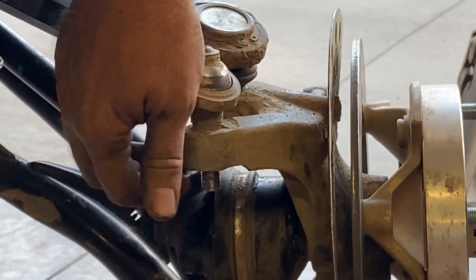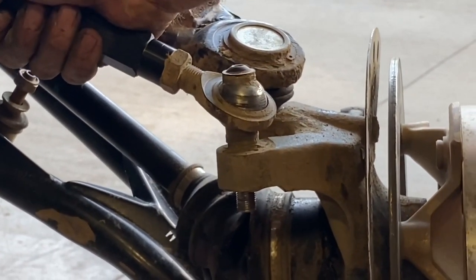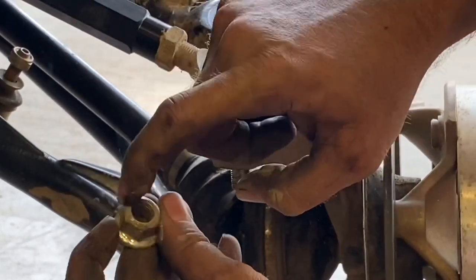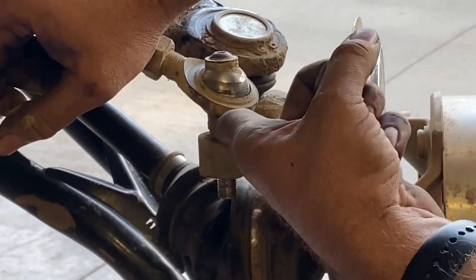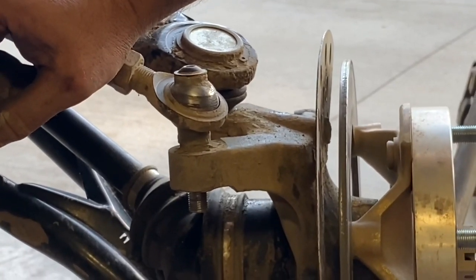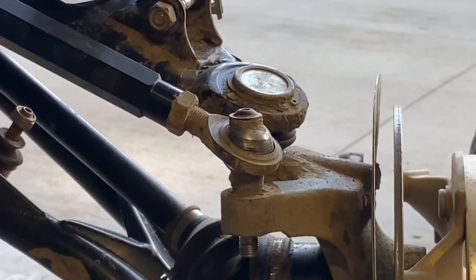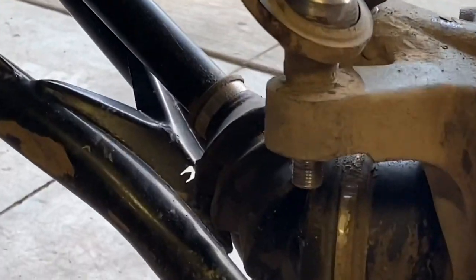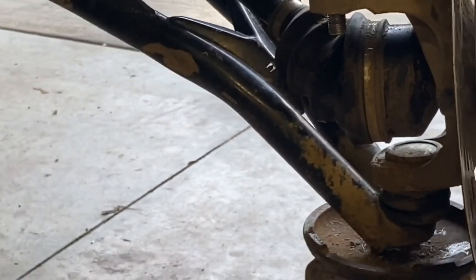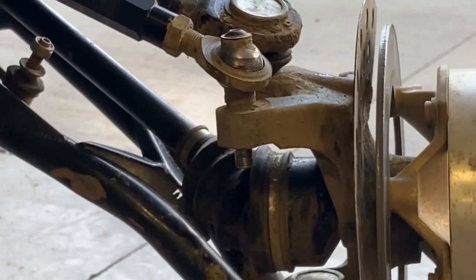You can see that it's a tapered fit for this tie rod end to go down into the spindle. Sometimes you can put the nut back up on the tie rod end and hit it with a hammer — be careful not to damage the end of the threads. You can also tap on the side while putting pressure with a pickle fork, but there are also pullers you can use. If you're ever installing Weller tie rods and putting that nut on the bottom of the bolt, do not use an impact on that. Weller highly recommends using a hand wrench — using an impact weakens the spindle and can cause it to break.